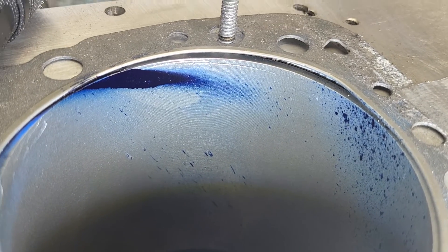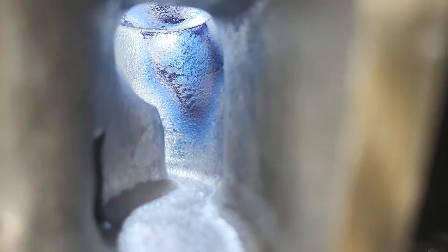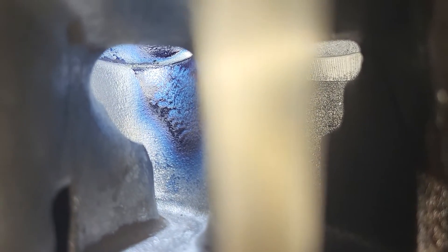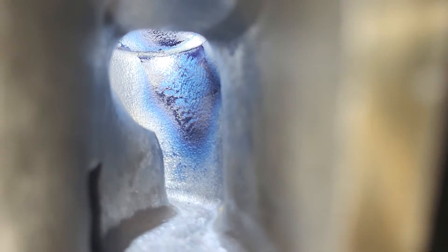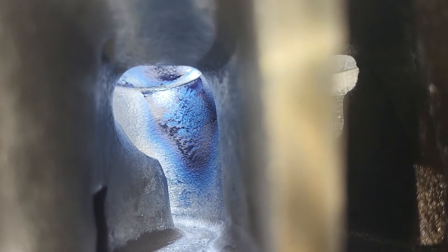I like the speckle action — give me some feedback whether you like it or hate it. I should remind you guys, this cut — the only thing I did is I put a little bit more angle on this, made this short side a little bit wider, give it a little more area to get air across on the short side. What I think that'll do is knock our swirl depth back a little bit, but we've got to get some flow through here, otherwise we'll never get the power we need.